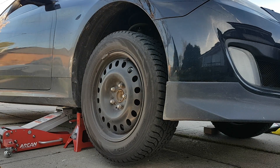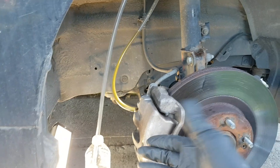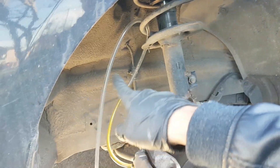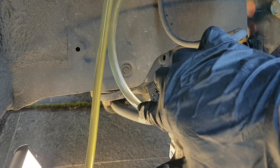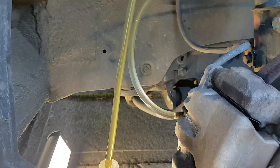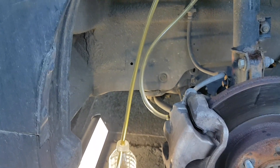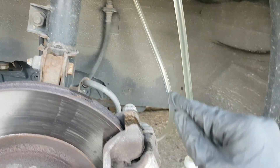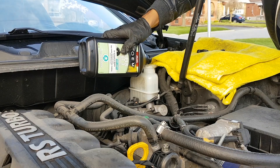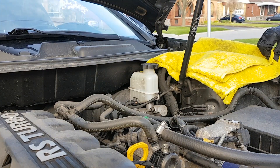Because the wheel spins, when you're taking off your front tire you're going to need to use an impact driver. When you're bleeding the front brakes, you can put your pipe around the coilover since there's no brake line to attach it to. Notice how clear the fluid is on the completed lines versus how dark the remaining ones are. Make sure you top off the reservoir tank every time you bleed a valve — otherwise you may suck in air and have to do the entire process again.